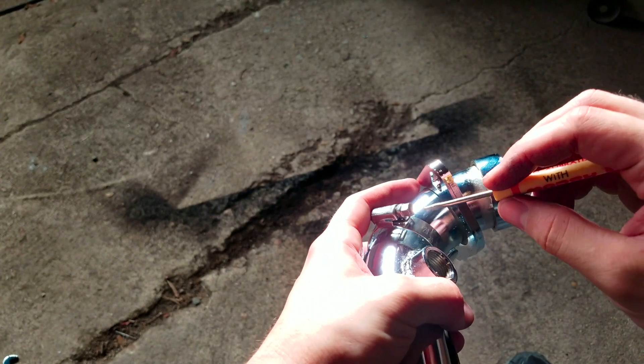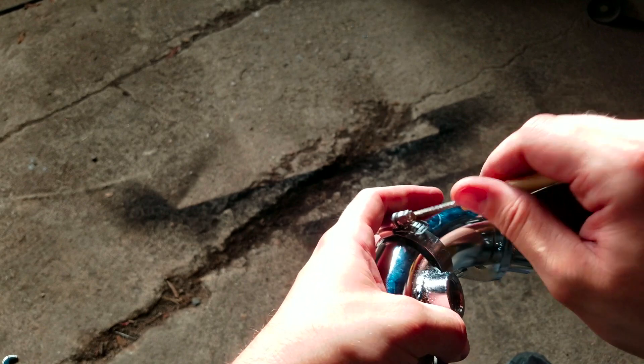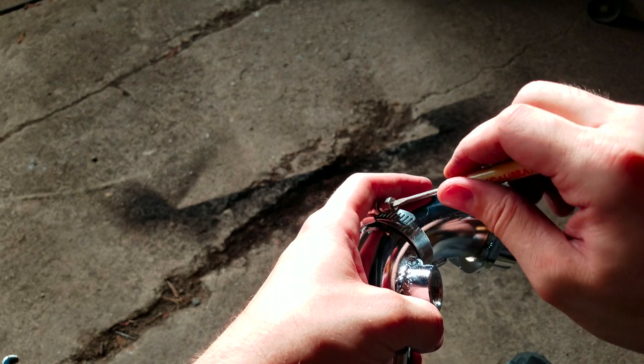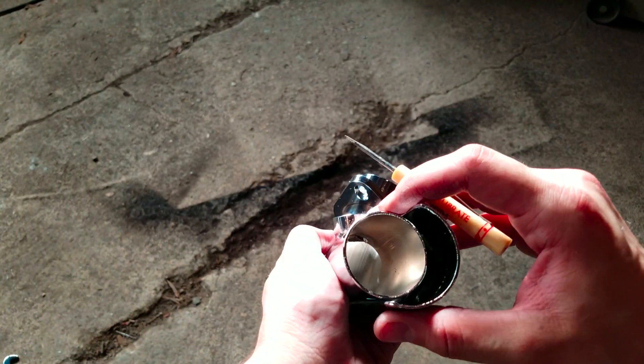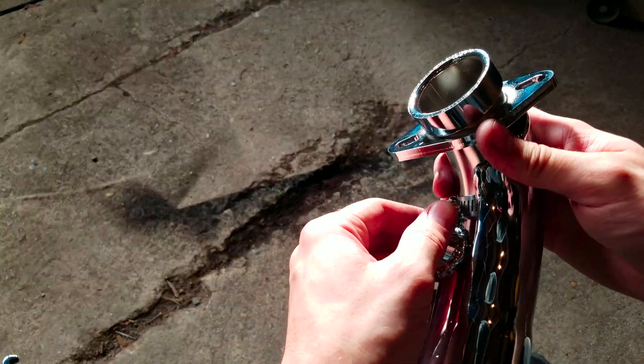Alright guys, so this has been a pretty much a clusterfuck of a day. The next part of the instructions says to take these hose clamps, put them on through here where the front header pipe's gonna go through, and you're gonna want them up this way. We're gonna have to fish it through here — hopefully not fuck anything else up. There we go. Now what we gotta do is put it on the front header pipe like so, so this is gonna have to go around. I can't fish it on through. All these little metal shavings coming out of nowhere — makes me feel great about the craftsmanship. Alright, there we go. Fit this on through the top. Just gonna tighten this enough to where it's loose and I can adjust it once it's finally installed.